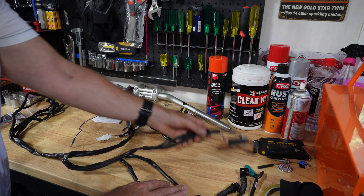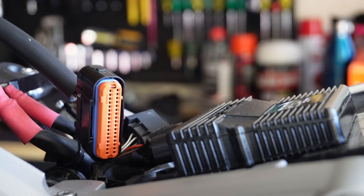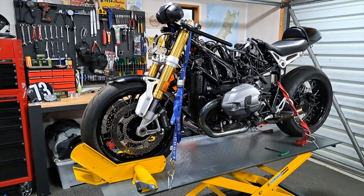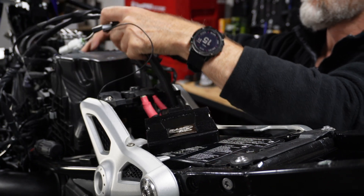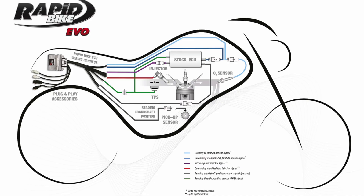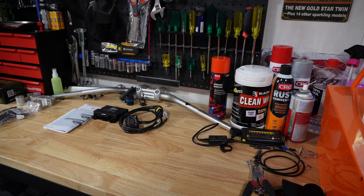These cables allow you to connect to your O2 sensor on the right-hand side, and they enable you to place the Rapid Bike module — the brain — in between the OE DME brain and the mechanical parts of your bike, like the TPS sensor and fuel injector sensors. Effectively, the module connectors are intercepting the incoming information normally controlled solely by your DME, enabling the Rapid Bike module to read the incoming signals and auto-tune by adjusting the outgoing signals to the engine.